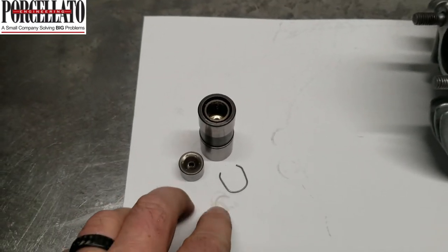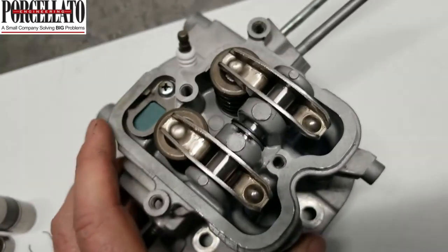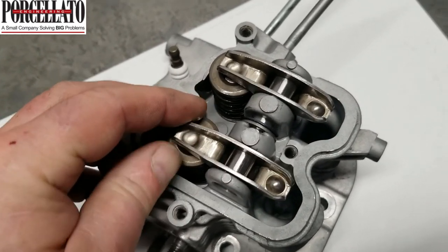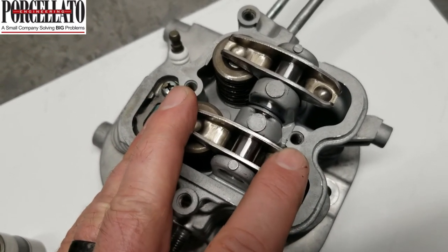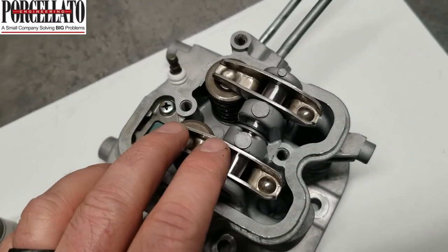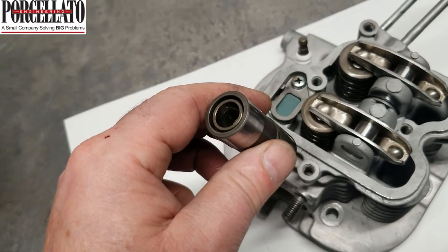If you ever have a club car that you shut off and then when you restart it you get a little bit of lifter noise, that lifter is probably not long for this world. I've got one on order and there's a little bit of delay to get this engine out of here. If your engine's assembled and you wanted to diagnose the problem — do you have a bad lifter? — you could idle the engine or run it however you want. Then shut it off, pull the valve cover, and the rocker arm should be firm. On a hydraulic lifter, it should be up tight against the valve and you shouldn't be able to push back against the lifter — what you're pushing back against is the spring. In this case, immediately after shutting it off, it was still firm, there was no problem, and that lifter was functioning normally. But after a couple of minutes, it was spongy again. So that shows us that the lifter was bleeding down internally, although everything looks great.